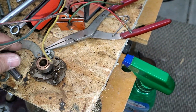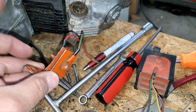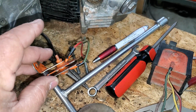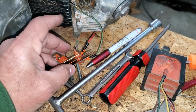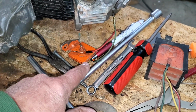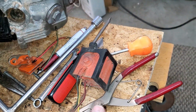This is the one for the little Honda Cub, as an example, that runs on a magneto. All it needed was enough to charge its little bitty battery so that it would run the tail light and the indicators and the speedo and things like that. So it's very light duty. It only has one winding inside of the flywheel, just as an example.